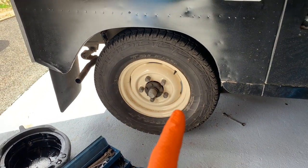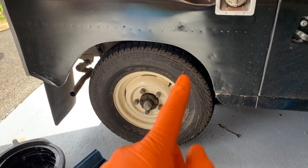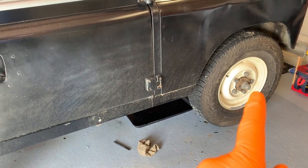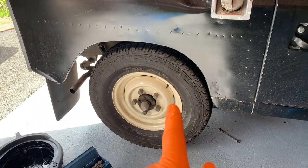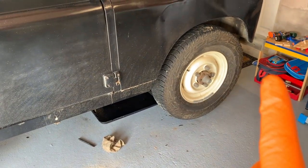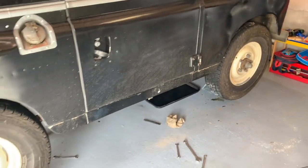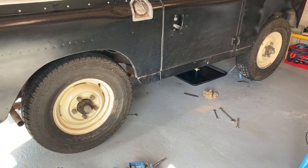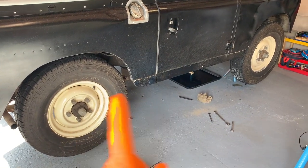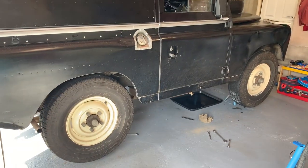Adjusting your brakes with the horrible little adjusters, which are on the fronts of the back wheels and the fronts of the rear wheels. I've done that the wrong way. Front of the back and front of the front wheels. There we go, got there in the end, didn't I? Make sure they're all tightened up, because it'll make a huge difference to your safety, especially if you've twin leading shoe setups or other modifications. I have the single leading shoes as standard that was on this 88 inch.